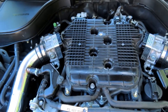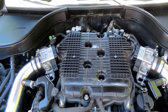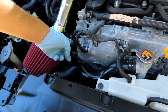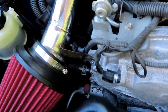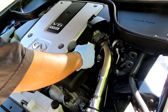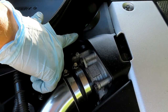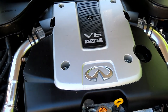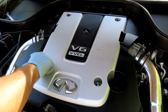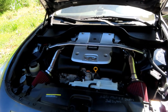The next thing to do is put my engine cover back on. The only adjustment I had to make was since I put an oversized filter for my intakes, it was kind of tight so I had to angle them slightly so they could clear this hose. The bracket right here I just had to bend it more that way, because with the spacer it pushes everything towards the front of the car a little — it makes the intake a little longer. The cover touches a little right here so you could cut this off if you don't want any rubbing, but I'm going to leave it as is. The cover's back on — that's all done, so I'm going to give it a startup and make sure it runs.